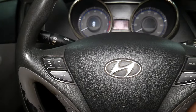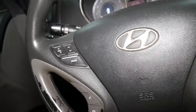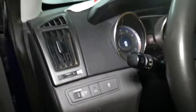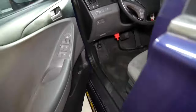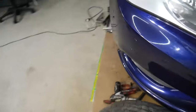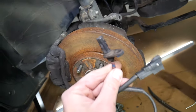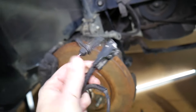So the top three things: the steering angle sensor is integrated in the steering column — we have a special video on how to remove and replace it. It could be a sensor that's not calibrated, a bad steering angle sensor, or a bad ABS wheel speed sensor. Here's what the ABS sensor looks like — it attaches right here to the hub. We have videos on how to test and replace them on the channel. Hopefully this video was helpful — thank you for watching and see you next time.